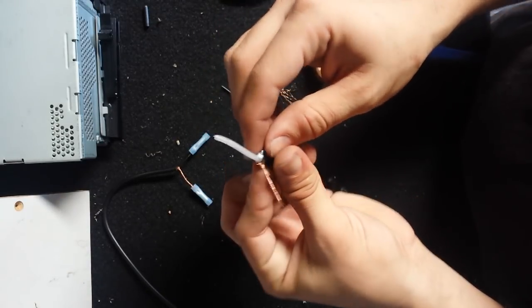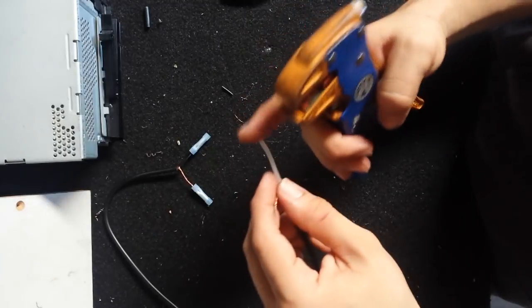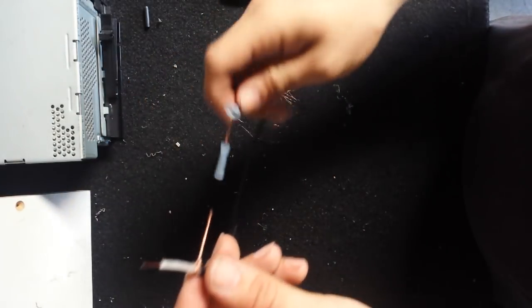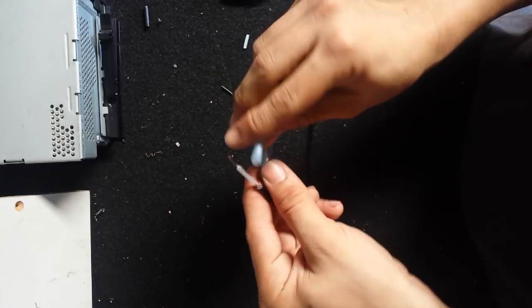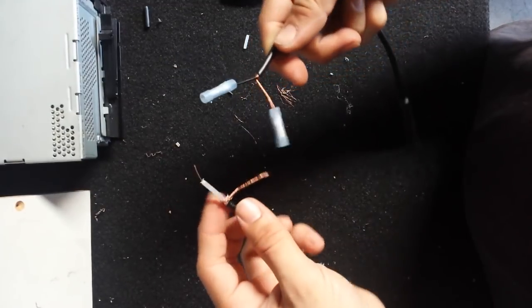And then that's just a little piece of foil. You can go ahead and rip that off. It won't get in the way, it won't do anything. Now there's the other side. It happens to be clear on this antenna, but same thing, it's just the wire you need. So all you're going to do is put the ground to ground, and then the two little insulated wires, the signal wires, together, and that's it. Just how they would be when they're inside before it got broke.